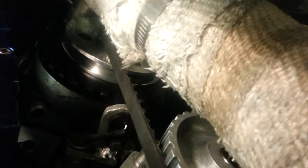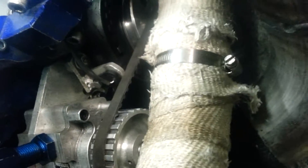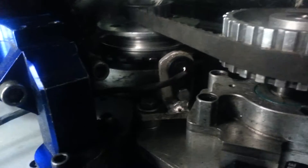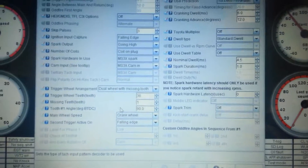On this one here, you can see the sensor is mounted at about 90 degrees on mine, but you could mount it down at the bottom under the oil pan — which would be under here. TDC is kind of like up right over there towards the driver side of the car. The sensor is mounted more like on the passenger side right here, so you can get the trigger wheel. So we're going to start the car and see if that mark is really at 90.